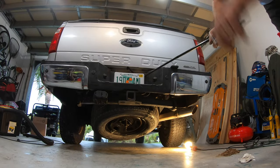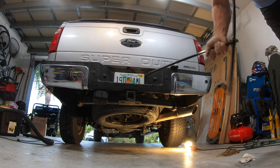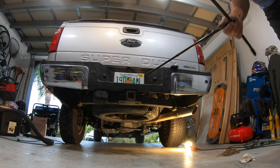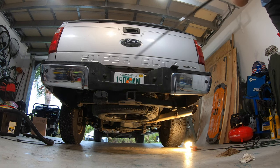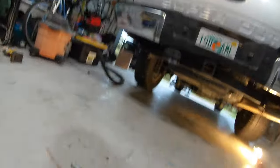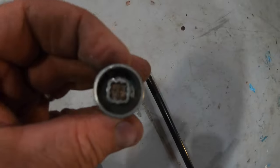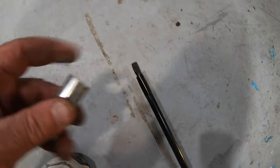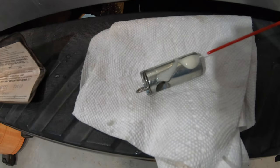For those of you not sure how to raise and lower the spare tire, you have to assemble this rod and put it in to the right of the license plate. On the very end of it is a locking lug-wrench type thing that should be in your glove compartment or console — it's unique to the truck. It has a spring-loaded little tip, it just pulls off, and before I put it away I cleaned the dirt out, sprayed it with a little penetrating oil to keep it from rusting, and put it back in its little zippered pouch with its identification card and into the glove compartment.